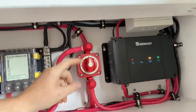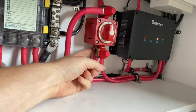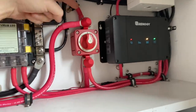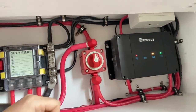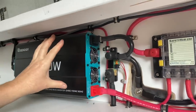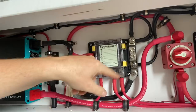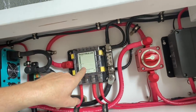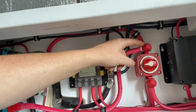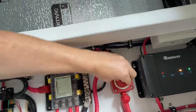The main battery switch — I set it up with a terminal fuse on this side plus the main battery wire going in, and a terminal fuse on this side and a battery wire coming out of that. So when you turn this switch off, it's turning off power to the inverter — the inverter no longer is getting any sort of feed — and also the DC distribution hub is no longer getting any feed. So that's where these two are going: that one's going to the inverter and the other one's going right here to this thing. Turn that back on.